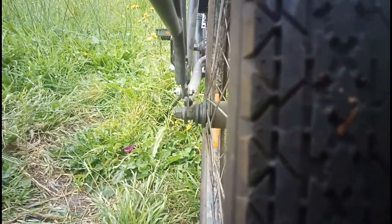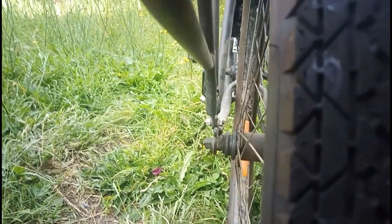I've been putting this off because I just don't want to have to deal with installing yet another rag joint over a coaster brake arm. I've always had to bend the coaster brake arm out and it's just been an absolute nightmare. But I've seen this trick where instead of using two rag joints you just use the one on the inside of the rim and have the sprocket hard up against the spokes. This is supposed to prevent the necessity for bending the coaster brake arm, but this process also has the risk of not clearing the tire.